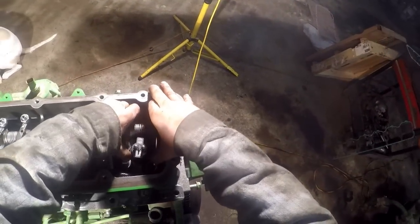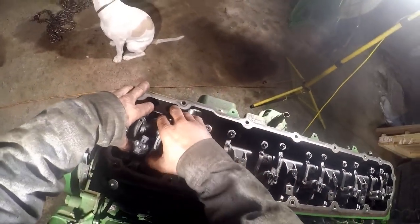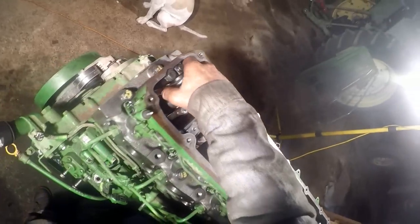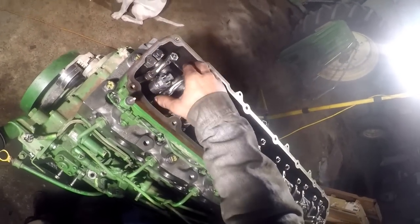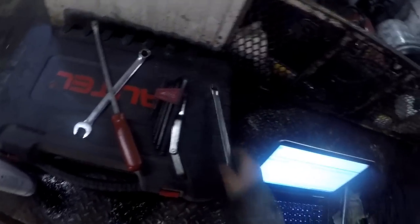Okay, now both valves on number 6 should be tight. They're tight. That's in valve overlap. See how tight this intake valve is? Just ain't right. It's a good thing you're doing the valve lash on it. Let's get her valve set, sweetheart.